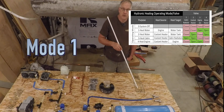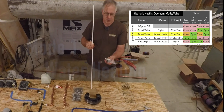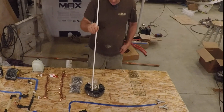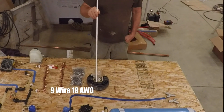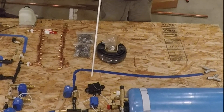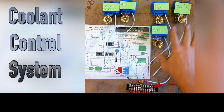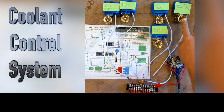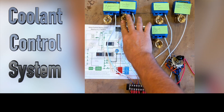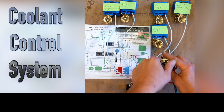This is my control panel. This is the mechanical switch that will allow me to select different operating modes. This 9-wire 18-gauge cable runs from the control center and this switch into this electrical box, to these electrical valves, to open and close them depending on what mode I want to operate in. This is my control system for the hydronic heating. Notice all valves are closed - these valves all control the flow of coolant into the water heater from the engine, from the diesel coolant heater, and into the cabin heat. They're all controlled by a simple mechanical switch; in the initial position they're all closed.